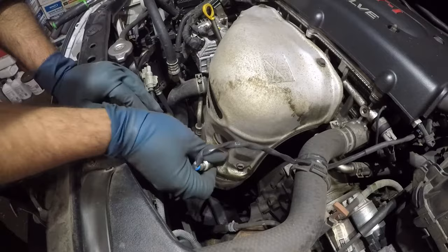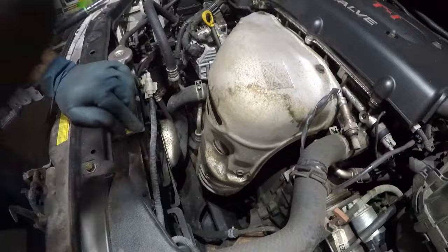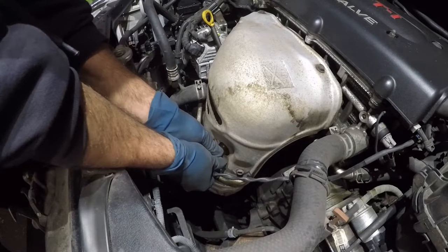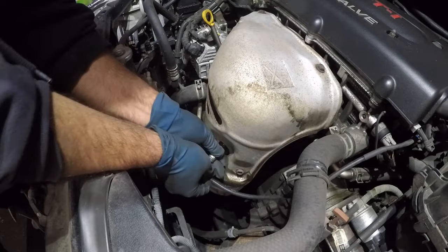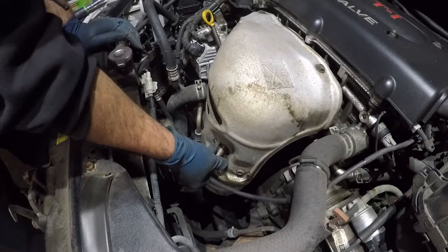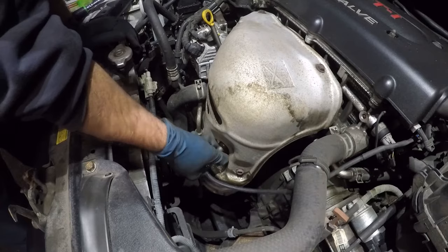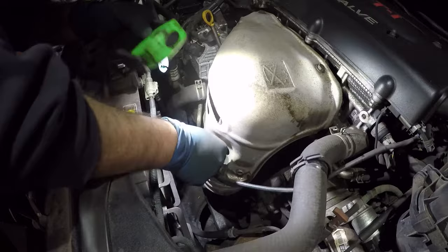I'm going to wait a few more minutes and do it again — about four times total. When I come back, I'm going to put this thing back together. All you're going to do is take the sensor and stick it back in. Let the car sit for a good 40 minutes after this. After that, you can reset the check engine light — you might need a scan tool for that. It's always worth buying a smaller scan tool so you can scan your own vehicles and do small repairs yourself.